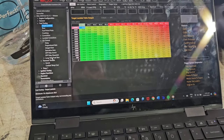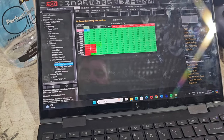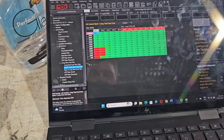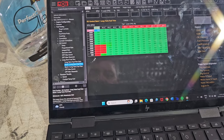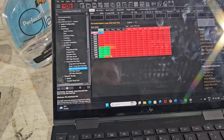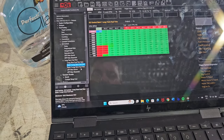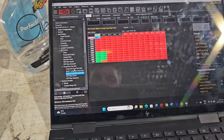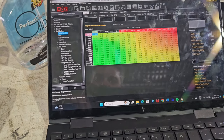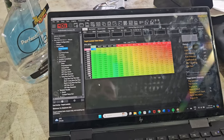Down in O2 control, long term — let's have a look what that was doing. You can see negative 10 there. I need to ask Scotty about this, because if the long-term trim is negative 10 and the bank thing is all positive, my opinion is that would cancel it all out — I'm not 100% sure. What I've done is richened it up in this area because it wanted 14.7 and it was lean popping, so I've gone a bit richer.